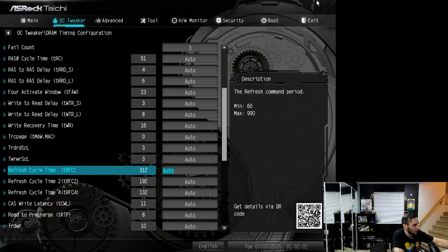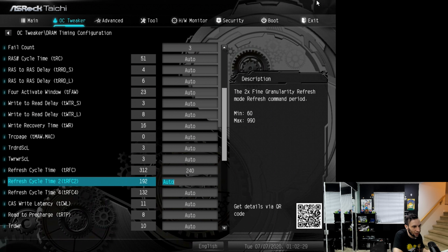So you already know that 312 is your stock number. You can go down by 20 increments on it. I mean, it's such a large number, it's going to have less of an impact. Like, going one at a time is going to take way too damn long. You know what I mean? So you go 300 to start, go to 280, go to 260, go to 240, and eventually you're either going to hit the wall where you can't be stable in OCCT, or you're going to hit the wall where it won't post anymore.